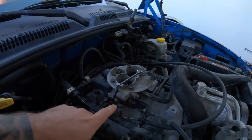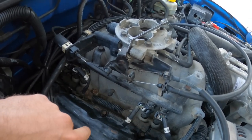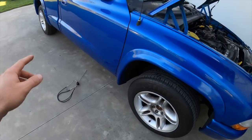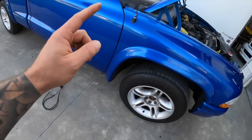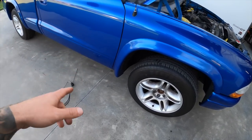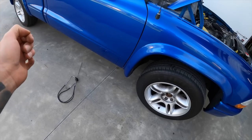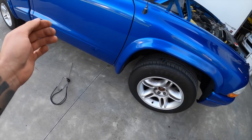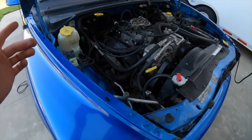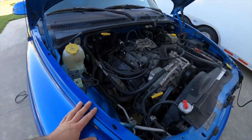I just shut it off for a minute. The reason it's idling high is I just put a little bit of feeler gauge behind the idle screw so that it would rev up to around 2000 RPM. I've got the stethoscope there, and when I put it on that transmission — right around the bell housing — that's where I'm getting the most noise. If I touch the oil pan, I don't really hear anything. If I touch the block, I kind of hear it. So it's got to be one or the other — either coming from the transmission or potentially the block.